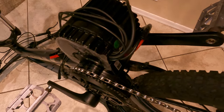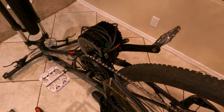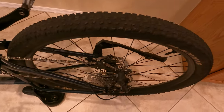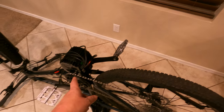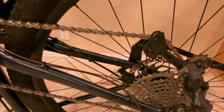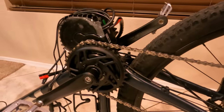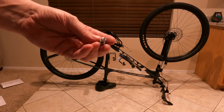I could get it to shift into all gears. It went into the lowest gear, but the chain ring threw the chain off due to the really skewed angle. It should be enough to test while I wait for the 42-tooth to come. This chain is pulled pretty tight to reach that gear, so when I go up to the 42-tooth I'm definitely going to need more chain length — I already got another chain for that.